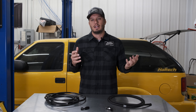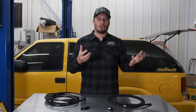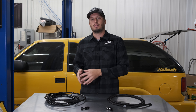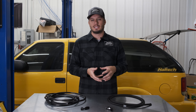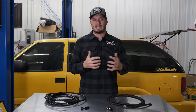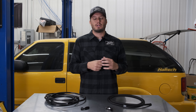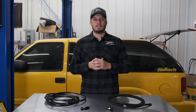One other topic that gets brought up with E85 is smell and permeation. This rubber style fuel line can actually start to seep fuel odor through it, which gets out into your garage. That is a true statement, and PTFE will not have that. However, most people have a vent on their fuel cell or fuel tank that's open to the air. So if you have an atmospheric vent on your fuel tank, you're probably not going to notice a noticeable difference anyway. In my mind, that whole topic is largely null and void. For the same reason, I don't think it's relevant that E85 could evaporate or pull in moisture through the hose — it's going to come in through the vent either way.